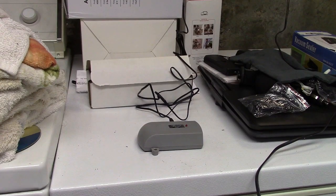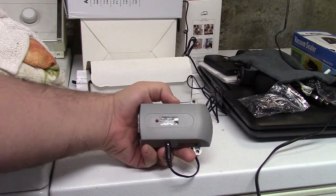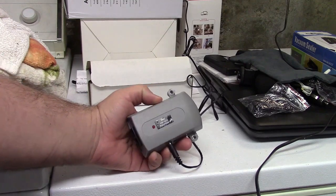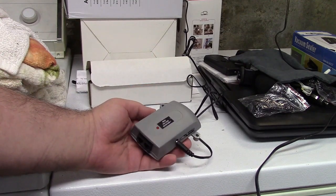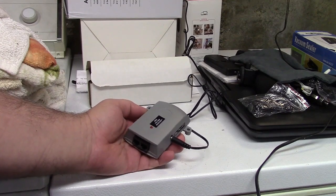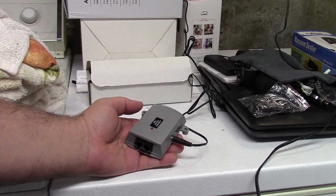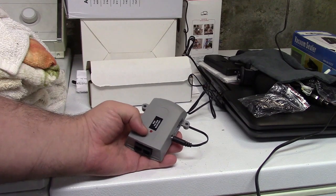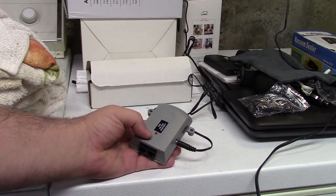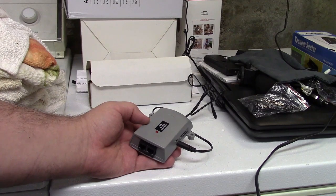This is a quick demonstration of what the Sandman Enterprise's Ring Voltage Booster 2 device was supposed to do. I had a video on this a number of years ago. It's supposed to add REN, or Ringer Equivalence Number, to the telephone line. When I used it to try to solve the low REN problem I had, it didn't work — it would trip out, cause the line to go off hook, and simply wouldn't work.